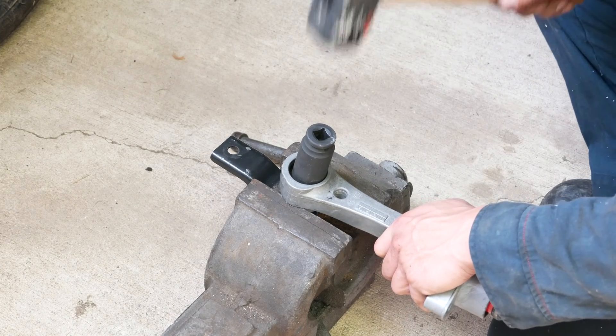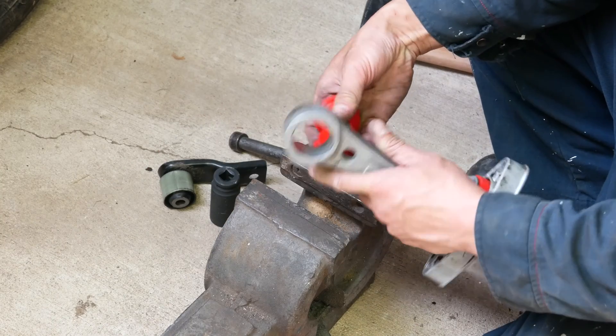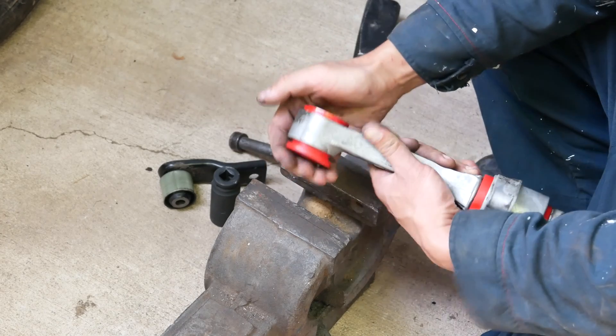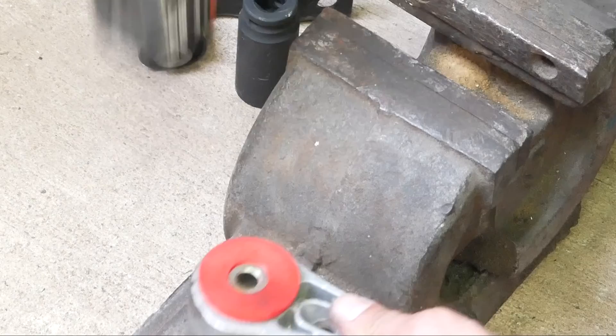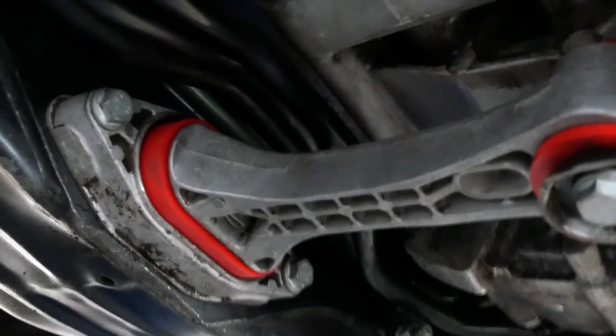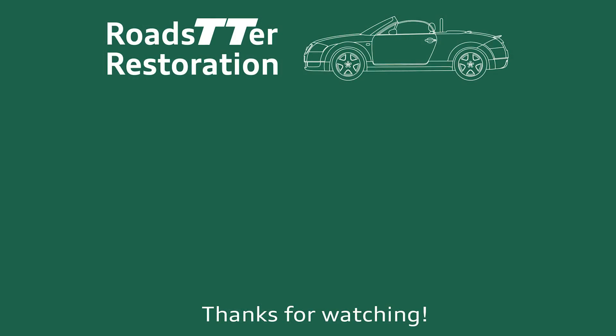Removing the round bush is really easy — all you need to do is use a 24mm socket and hit the old bush out. Install the poly bush with the insert and pry the black arm off from the OEM bush. Once that's done you can get under the car and install the refreshed and upgraded dog bone. Torque specs are in the description below, and be careful not to force the gearbox bolts in, otherwise you risk stripping the soft aluminium threads. So that's it for this round of the Audi TT restoration — thanks heaps for keeping up. Click on the Audi TT Mark 1 playlist and remember to like and subscribe for all future updates. See you next time!